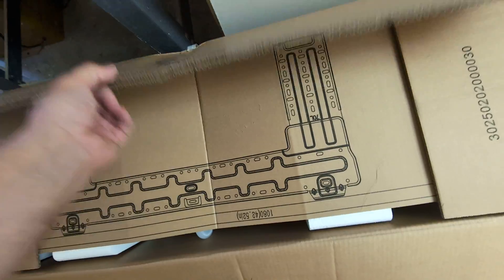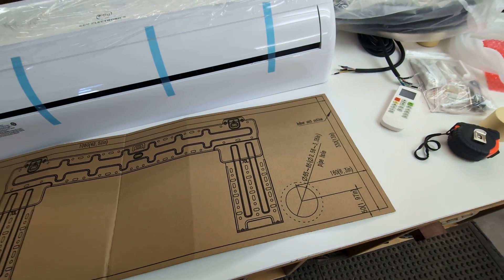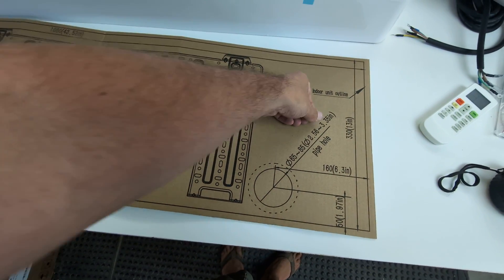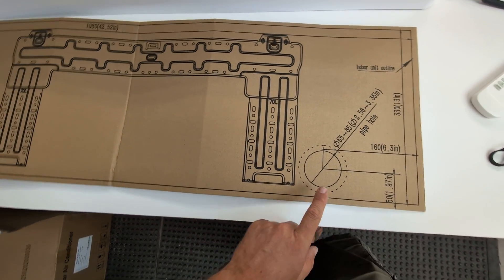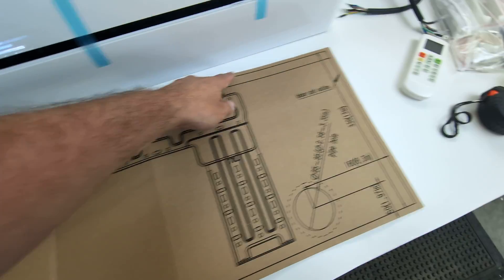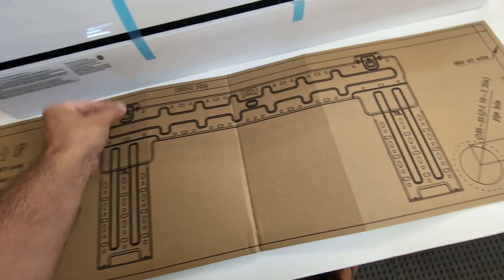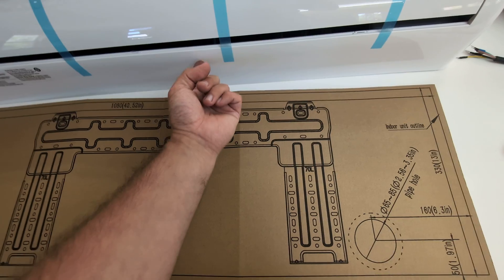The one tool you'll really need — other than a little electric line to run your power to it — is a hole saw drill bit. It's listed right here: 3.35 inches, basically three and a third inches. That's where you drill the hole in the wall. This template is a one-to-one scale — the upward direction is marked, and the outer black line describes the shape on the wall so you can pre-orient it. Use push pins to hold it in place, then pre-drill all the attachment holes for the metal bracket on the back of the unit.